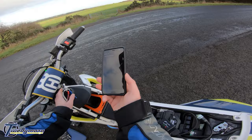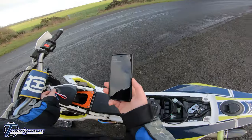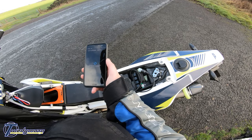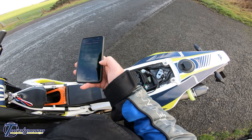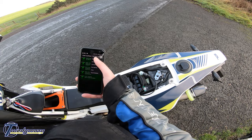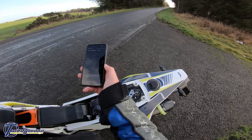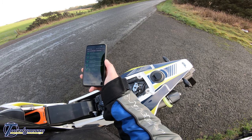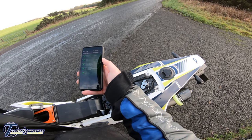Complete! So usually, you have to turn the engine off and turn it back on and do a rescan to make sure they've cleared. So it can see what there has been. Let's start it and do a refresh. Oh wait, O2 sensor. Oh yeah, that's unplugged. Reset. Search. Yeah, so those are old faults. All good to go.